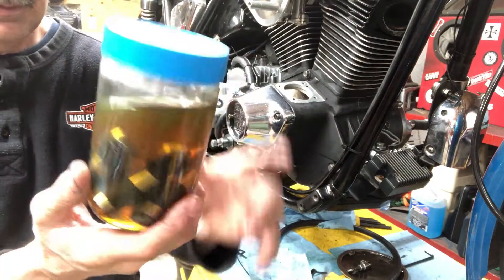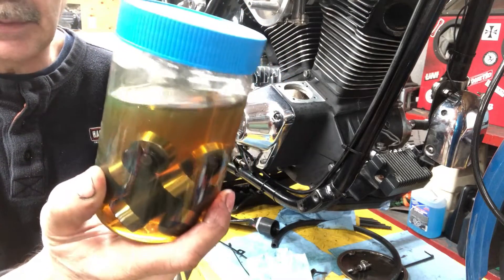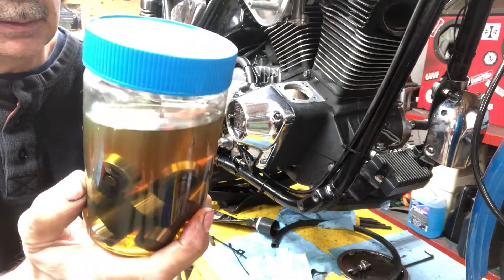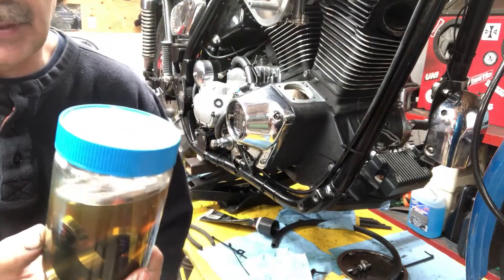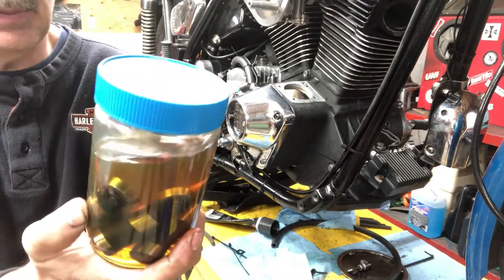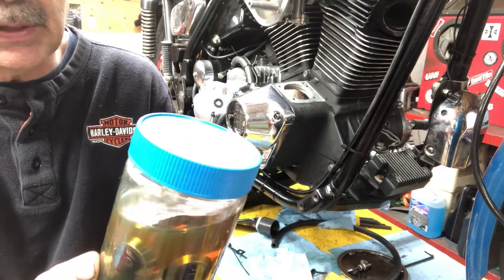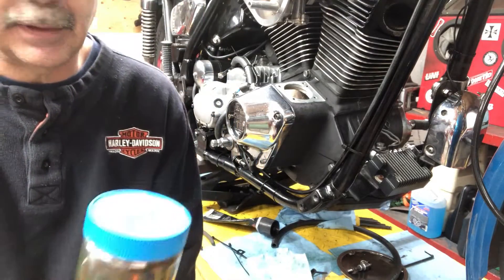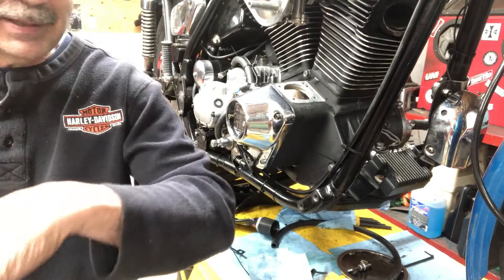That's those Fueling lifters. They're the most expensive lifters you can get for the Harleys — they're the best ones, they're low leak-down. Those S&S ones, once the bike gets warmed up they start leaking down and tapping like crazy. These are the best ones. You just have to soak them in oil for maybe 6, 8, 12 hours, but they've been in here for like 4 or 5 days — I was too busy on the Norton.